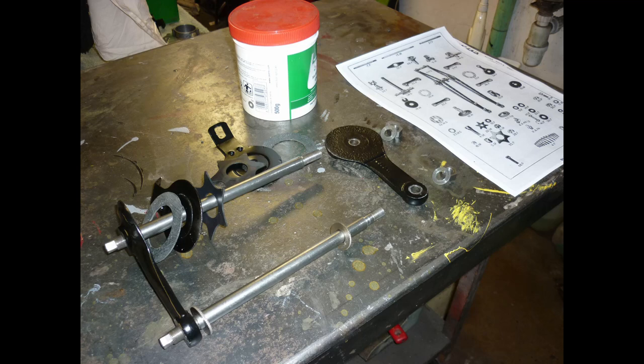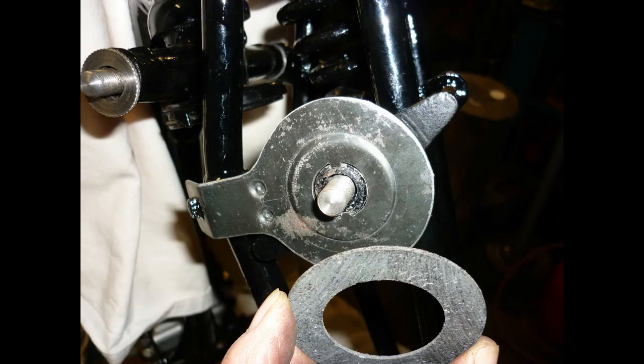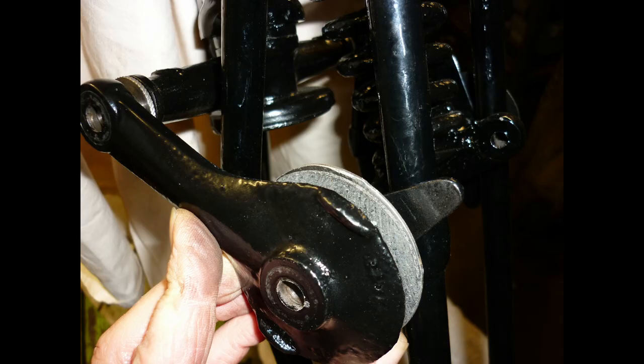The lower links are ready for assembly. A butterfly at the rear adjusts pressure on the star spring. The link is threaded and nuts lock its position on the new spindle, the opposite side nipped against the shoulder. Some designs use right and left hand threaded spindle ends working in tandem for adjustment of side play.